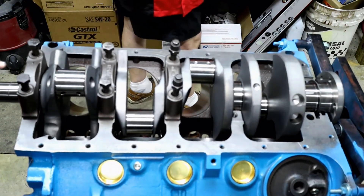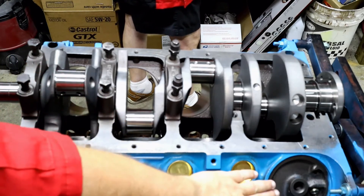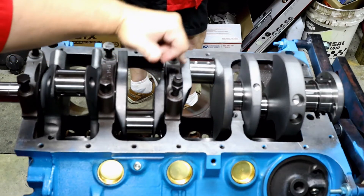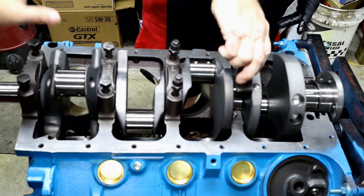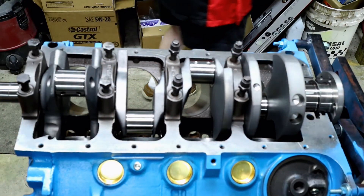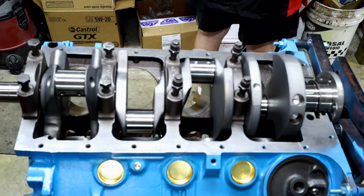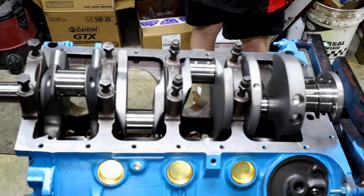Note the numbers — everything is facing this side. We have our oil filter on this side, and our numbers line up straight with this side. The one is facing that way, the two is up here, three, four — making sure these are all matched, making sure they're all snug, making sure they go in properly. If they are too loose, that's an issue. But we're pretty confident these were all the original caps for this block.